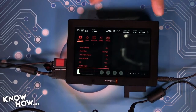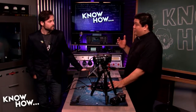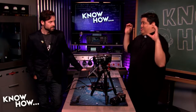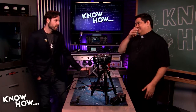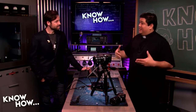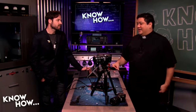We're going to run into the same thing I had with the microcinema — it's going to be recording in 422HQ ProRes. Huge files. We used to record everything at Twit in ProRes, and those are big, big files. People like them, and the reason Blackmagic does it is because they're a higher-end manufacturer — especially important if you're doing any post-processing. So it's worth it, but just know your files will be large.